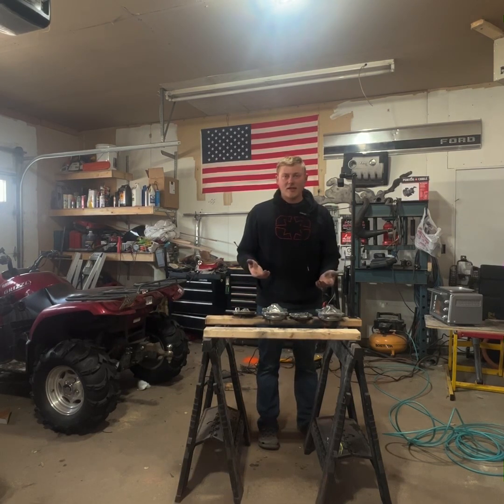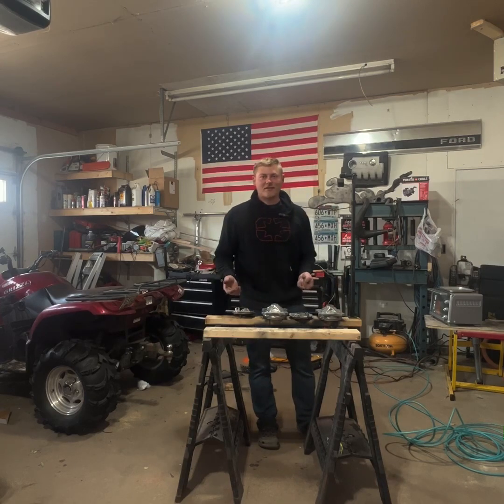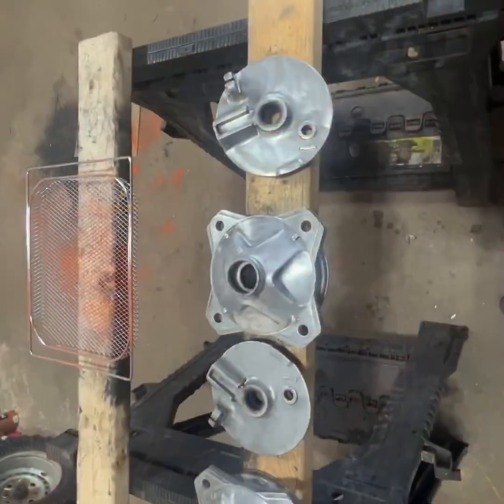It really helps with the adhesion. My first piece I didn't preheat it, and after I baked it in the oven with the powder on it, it got a lot of air bubbles in it, and it really didn't turn out good. And every piece I've preheated since then has turned out a lot better. So that's just been my process going forward from that point.